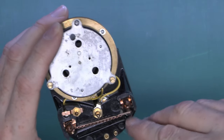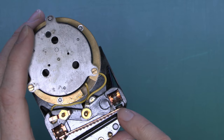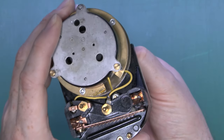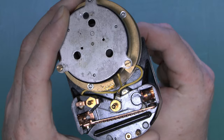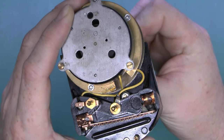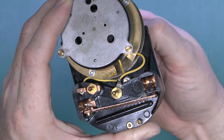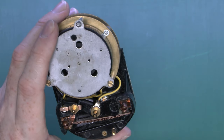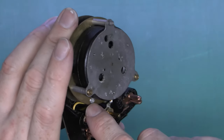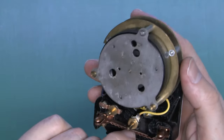On the back here, you can see the actual contact - this is basically this long strip here, and the contacts are actually at this end where there's a little round button-type contact on the end. So as the dial rotates on the front, we should be able to see those open and close. So that would be the off position and then that's the on position. So this is essentially the switch contact - it's in and out. The other two pins here just power the motor there through the yellow wires, and it's coming off those two and going straight up into the motor. So those are permanently powered, and you just use this as a switch to control whatever load you're wanting to switch on and off.